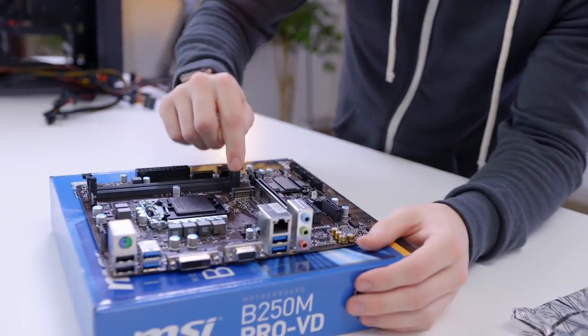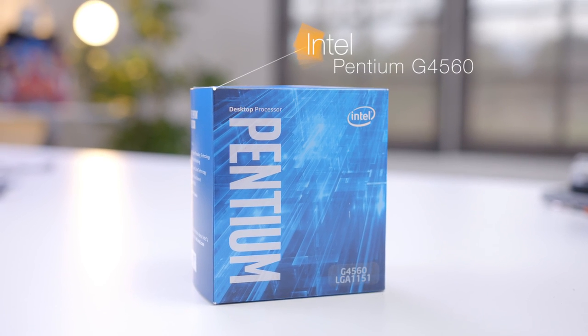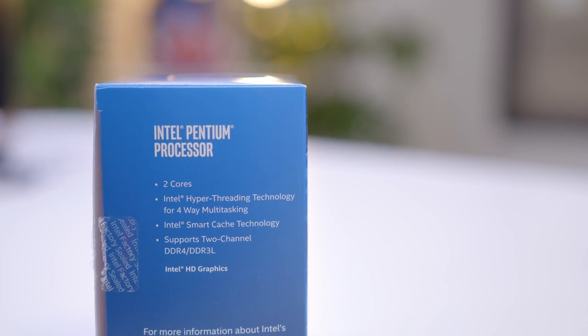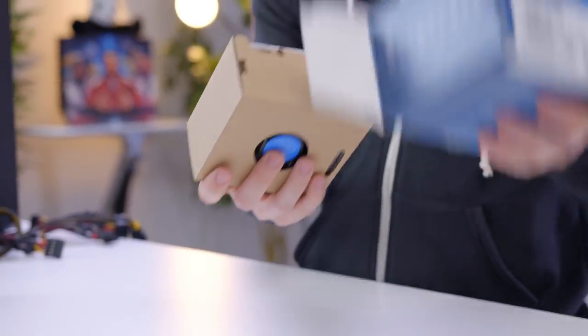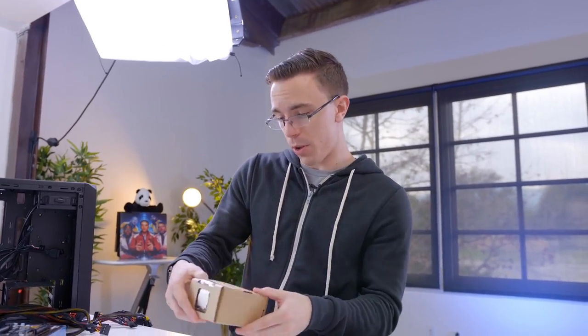Trust me, it happens. On top of that, we also have an M.2 slot which not only supports SSDs, but also the new Intel Optane. Powering the Boson 4.0 is the new Intel Pentium G4560. Typically Pentiums haven't been good for gaming builds, but what's special about this is that it supports hyper-threading, essentially turning this into a Core i3 that costs a whole lot less. So even though it might be cheap, don't underestimate the Pentium. With a clock speed of 3.5 GHz, it really isn't that far off from even higher end chips like the Core i5, depending on the game, and for a build like this it's going to be pretty much perfect.